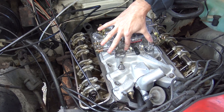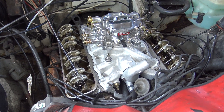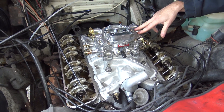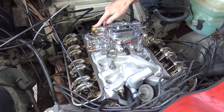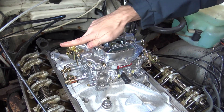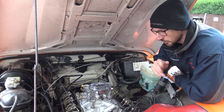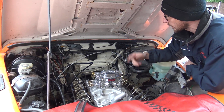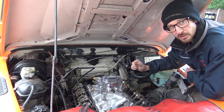Holly's got the intake manifold, thermostat housing and carburettor bolted on. The throttle cable's on the bracket as well. We've left this port open, ready for the vacuum advance on the distributor. Steve has already jetted this accordingly for a 3.5, and has also done all the float bar heights, droop and everything, so that's pre-set. All we've got to do is the base mixtures on these two mixture screws when we get the car up and running. We also install a fuel banjo on this carburettor when we supply it as a kit so that we can properly angle the fuel pipe to it under the air cleaner, because the standard one that comes straight out actually fouls the air cleaner.